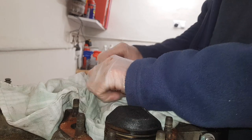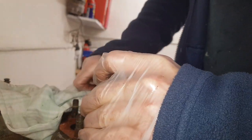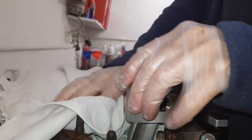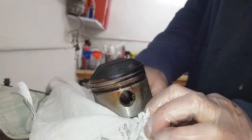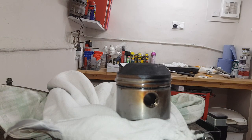Okay, here we go with the piston removal - starting with the timing side piston. I'm just going to protect the conrods for now and I'll protect them properly once all the pistons are off. Rotating the engine to get this one near top dead centre. I've packed the aperture a bit more to make sure we don't lose the circlip.